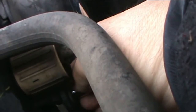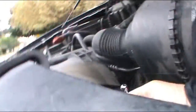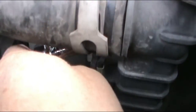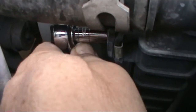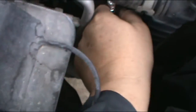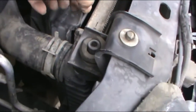What I'm trying to do right here is just to determine if the water leak actually comes from the radiator. So let's take that bolt out, and same on the other side. I'm going to proceed to remove the bolt on that side — again, this is right below the top of the water hose. I ended up doing the last part by hand. Now we've got this loose and we're going to try to see through there.